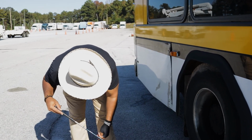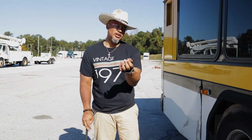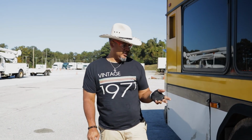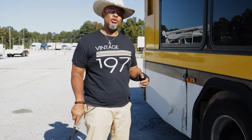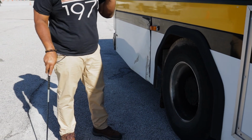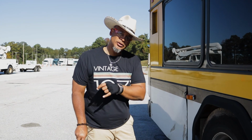And I have back here my valve stem, properly mounted and secured, not cracked, bent, or broken. The valve stem is not damaged, and I can use that valve stem, all right, to check the pressure on that tire to make sure my inflation is good, all right? So now we're gonna go to the rim, properly mounted and secured, not cracked, bent, or broken. All hardware is present. Not dangerously worn, thin, or I'm thinking about brakes, y'all. No unauthorized welds on the rim.